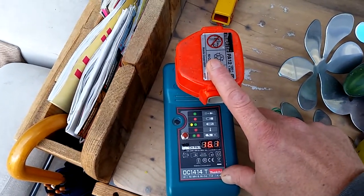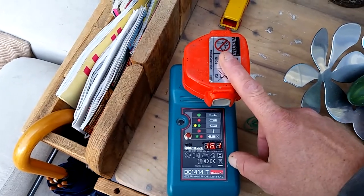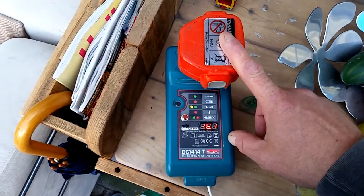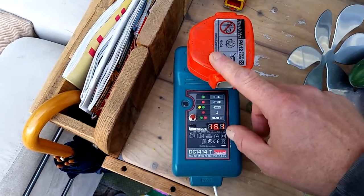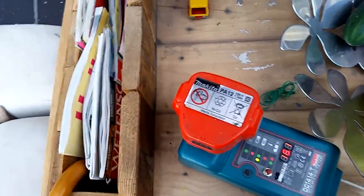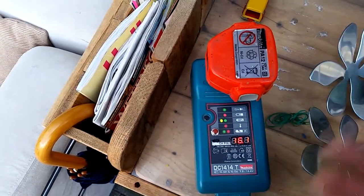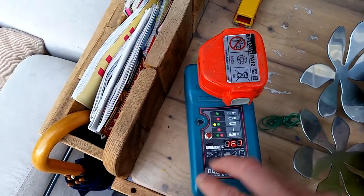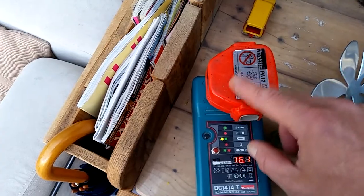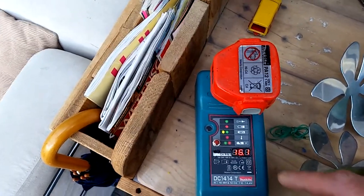So I have a charger made with a RE-EMF charger. I use old laptop batteries, lithium-ion — you can also buy new ones, they're not expensive anymore. Open up your old batteries, rip the old cells out, put four lithium-ion cells in series and you have a great battery-powered drilling machine that goes a long way. The machines themselves, like Makita, are really sturdy — every hobbyist knows this brand. It's always the battery pack or charger that dies. Once you build in this RE-EMF charger and replace the batteries inside, you're good to go again for a really long time. And once the batteries eventually die, just put in four new ones — it will cost you hardly anything.